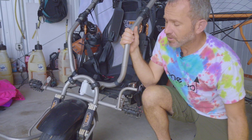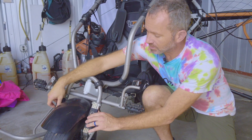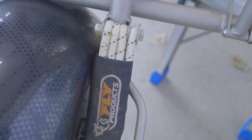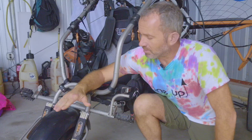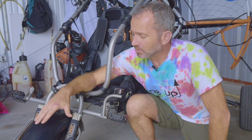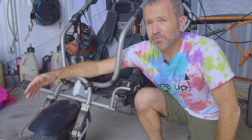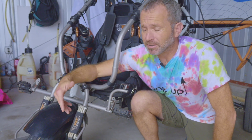On the front end you've also got your suspension system for the nose wheel, which is a bungee-type suspension system. We've found that after about a hundred to a hundred and fifty hours, the bungees do get soft over time because they've been stretched so many times. If you jump on the front end and it compresses all the way, it's probably time to replace the bungee system. We can get that for you, and you will find a marked improvement — it's fairly inexpensive.